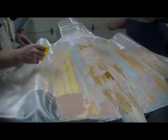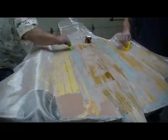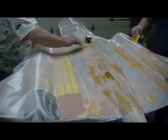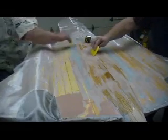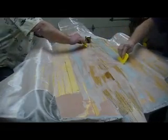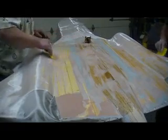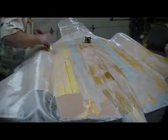When I get low I'll just turn my cup upside down in a spot and let it drain the rest of the way out. You don't want to mix up great big amounts of this stuff at a time. I want to come along and scrape some of my excess out of there. Same way as Bondo — don't mix up big amounts, or it'll just end up setting up in your cup. The more you mix up the faster it sets off.